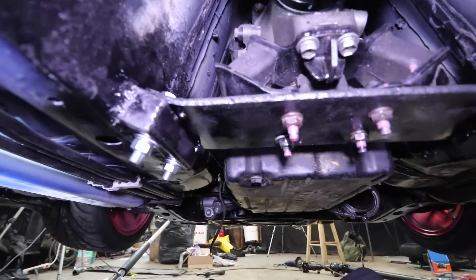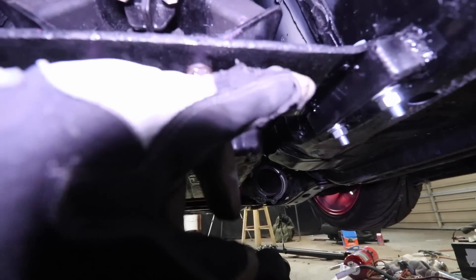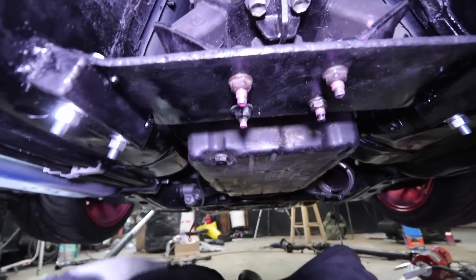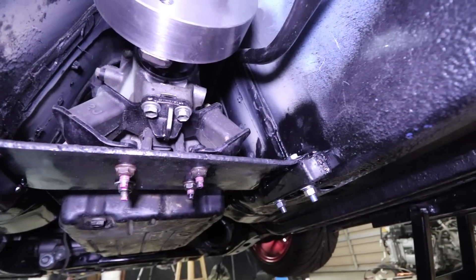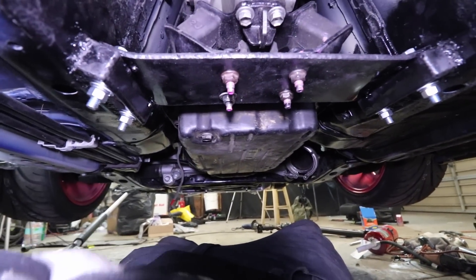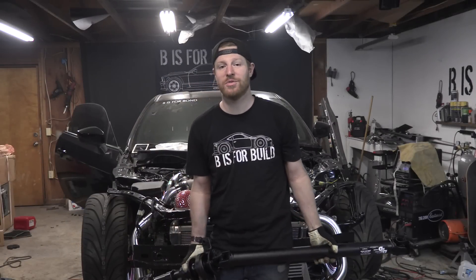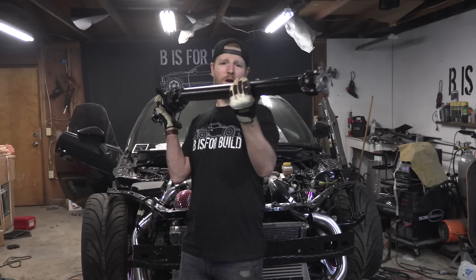Here's a final look at the transmission mount installed — all the installation went easy breezy. Here are the two pieces welded on the body, with bolts going down through them, and then the transmission mount bushing with its own bolts coming down through, nuts on all of those, and we're all mounted up. The transmission is a little higher than it was before, which gives us clearance on that shifter linkage. Now it's time to install our new driveline — let's bring this thing home.